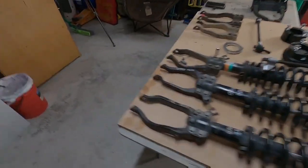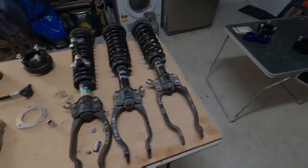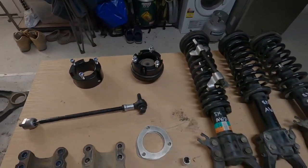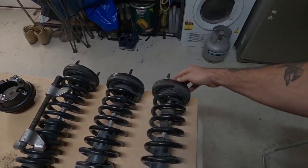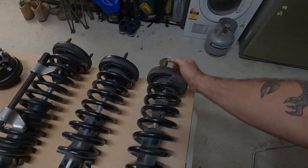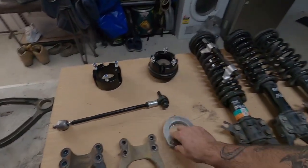To keep it cheaper in the front, go with the longer SZ forks or a 35 mm bolt-on spacer. If the longer fork isn't enough, add a flat slip-on spacer on top. Search Prado 120 for your spacers.